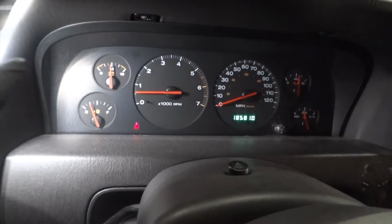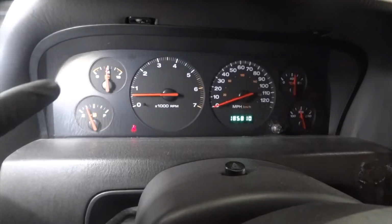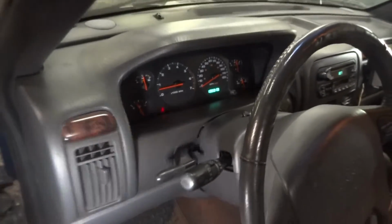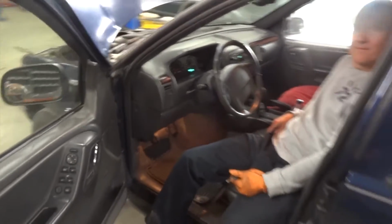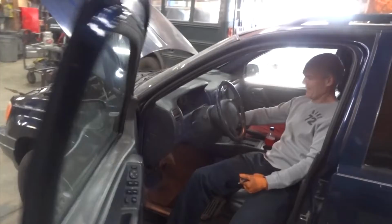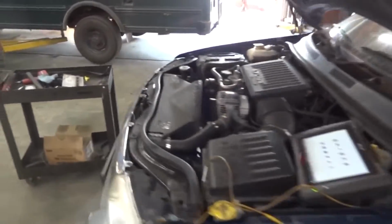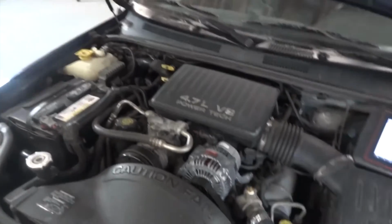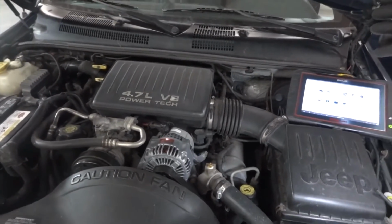So we're looking at this gauge over here. Yeah, this one. So we're reading 14 volts. So that's good. Our charging system is working. Perfect. Good job, Bishop. Off? Yes. Let's turn it off for now. So now I'm going to connect to the battery. And then we're going to start the engine again. So we have 14 volts on the dash.